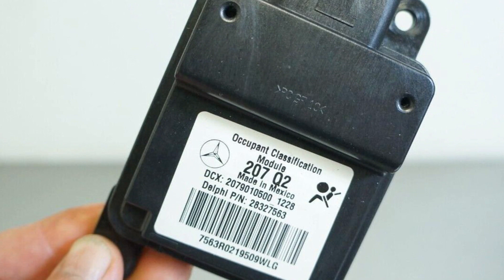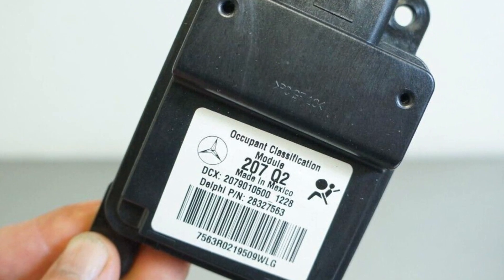There was a dealership note from Mercedes with a certain manual on what to do with the situation. This note instructs the dealers to clean the connectors in the seat occupancy system with a special tool. So this is probably the first thing you need to try.